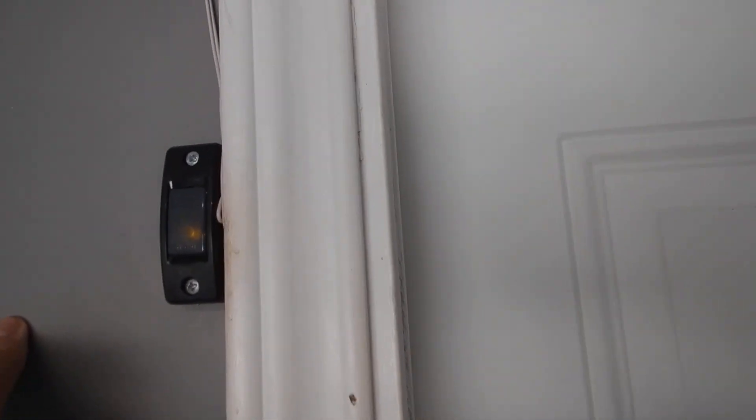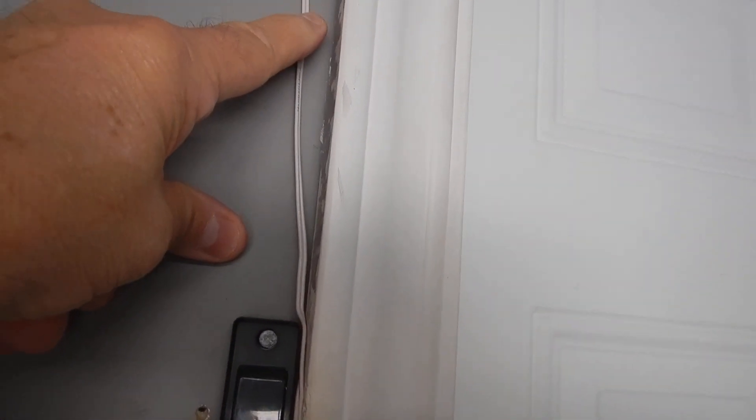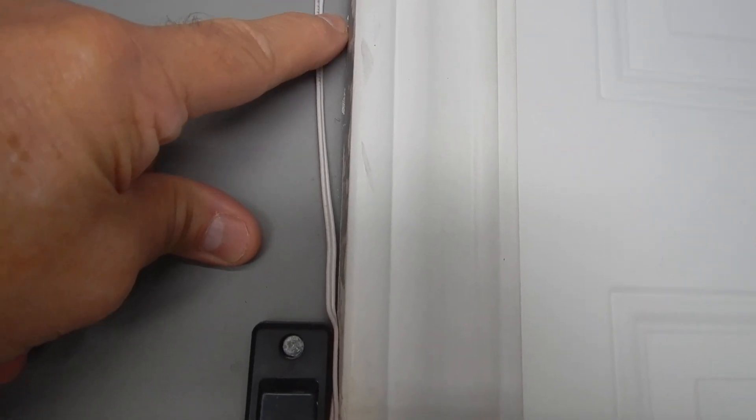These are the control wires, and they're secured with metal staples — we have this same condition in the kitchen cupboard countertop luminaries. The metal staple can chew through the insulation and short it out, causing the door to malfunction.